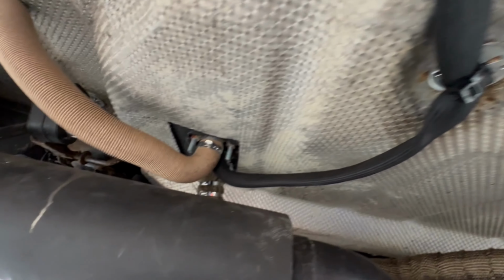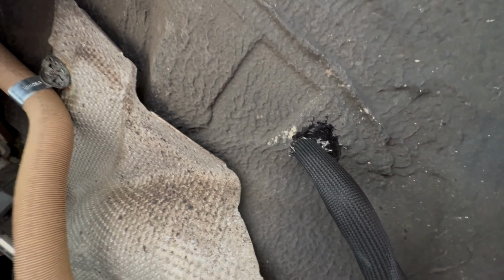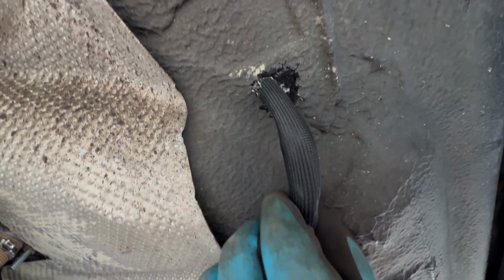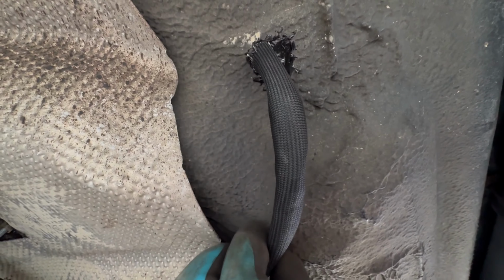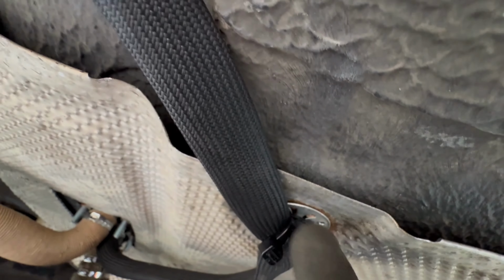Wait, no, it's here. The fuel line is attached underneath here. Two L-shaped 90-degree Webasto rubber mounts, 90-degree bends, sorry. Terrible, trying to think of what words to use. And then they are crimped into place, and then I've got this heat resistant covering going over the top, and then again using just a P-clip and a zip tie, using the heat shield stud again to keep it out the way of the exhaust. But that should be absolutely fine.